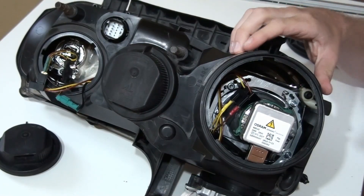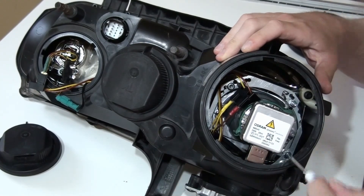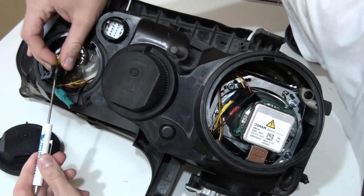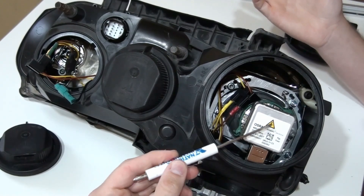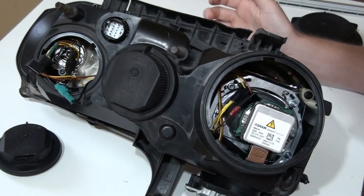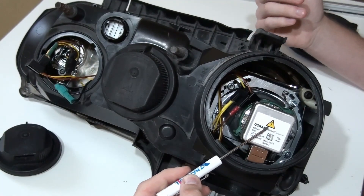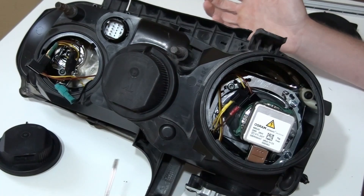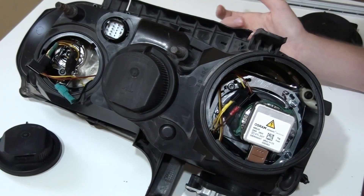Let's shortly discuss how the high beam solenoid operates here. The easiest way to connect the high beam solenoid would be to take the two wires that are fed right here and just connect them to the power of the high beam bulb. However, imagine a situation in which you drive during the day and you don't use your low beam headlamps — you just want to flash your high beams to communicate with other drivers. When you directly connect the solenoid to the power of the high beam bulb, even though the xenon bulb is not turned on, you're actuating this solenoid for no good reason. This is also not good because it's an inductive load that is not really good for electronics that switch everything in a car.